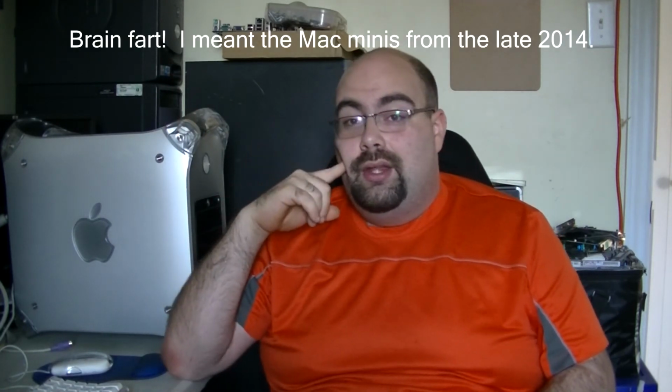The design must have been from the early 2000s anyways, and, well, maybe late 90s. Who cares? This computer is very capable of doing today's computing needs anyways. And the latest operating systems won't support it because it's a PowerPC, not an Intel. Now, that wouldn't have been a big deal, but there are some very early Intels, like the Core 2 Duos, that won't support OS X 10.8 either because their CPUs are just not supported. They make their computers so that after 4 or 5 years, you've got to either stick with it or change it if you want to upgrade again.